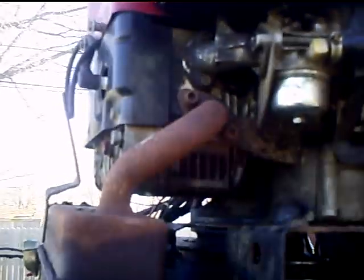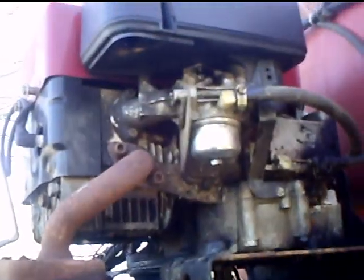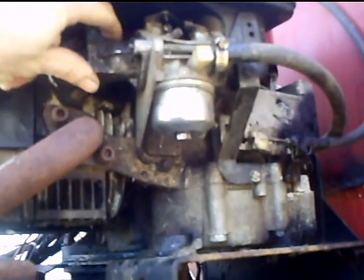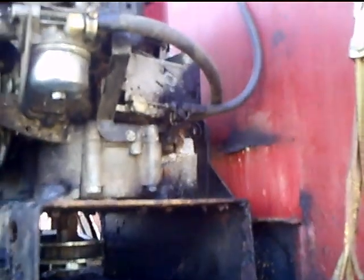Now what I'm going to do — first off — fix this carburetor issue, it's just dumping gas everywhere, flooding it out. The biggest issue with that was the old engine that was on here had a vacuum-powered fuel pump. It just mounted inside the intake here on the other engine. This little vacuum tube came out and a little pump sat somewhere over here.